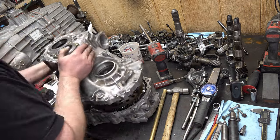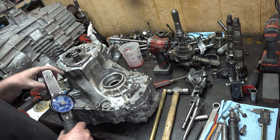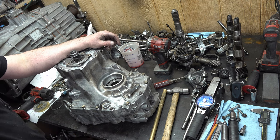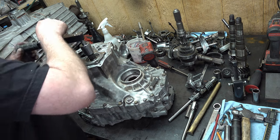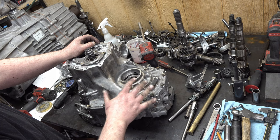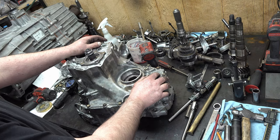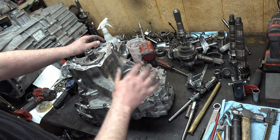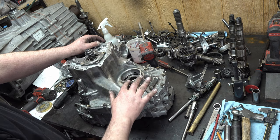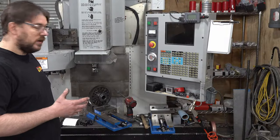When we don't have something we need, we make it. We're at 2.15 millimeters thick — that should get us in the right range. We're at 11 inch-pounds, so we need to take about another 0.05 millimeters off that shim. It's annoying but doing it right matters. I reground that shim two more times and ended right at 2.05 millimeters. I'm tired and shaking, but I can see it is lower — it's reading about 8, which is right where it should be, on the lower end but keep in mind we have the gear ratio change. In a few seconds you'll see me actually start assembling this thing — at this point everything is all shimmed in.